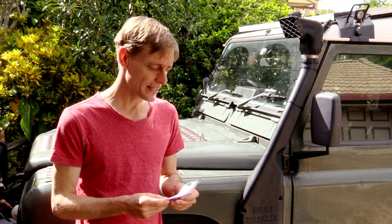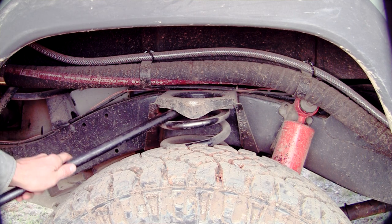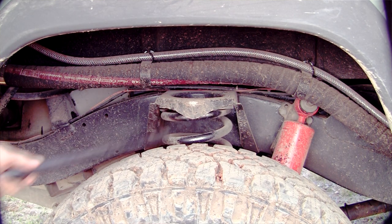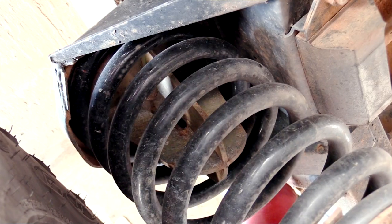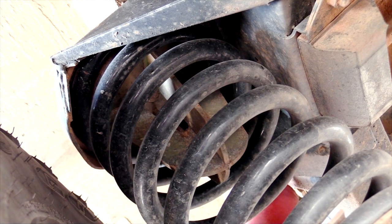I also had a rear spring pop out when I was under full extension. I think this may have been caused by the shocks being long travel with an extra 40 millimeters, just enough to allow the spring to pop out of its seating. But this was easily rectified and I've put some dislocation cones in the rear just to protect this from any future occurrence.